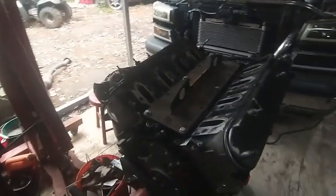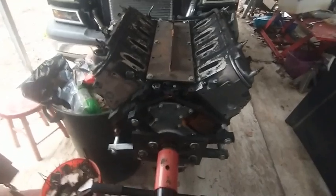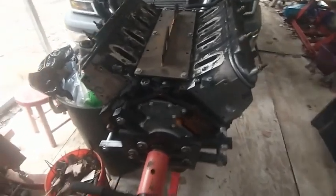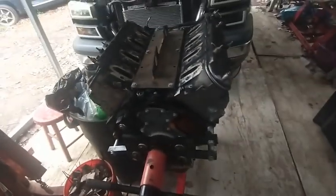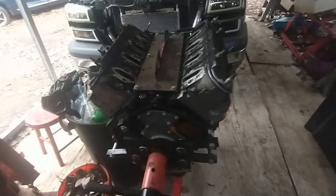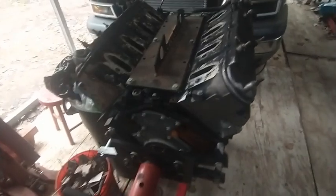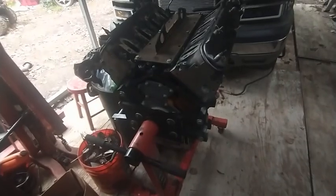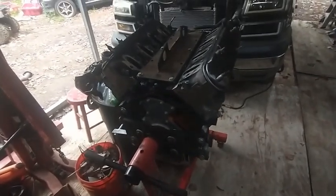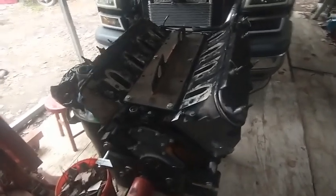So I'm kind of thinking, and I want your guys' input on this, is to, of course, do this on a budget. I don't know really what I'm going to pick for a budget. I think I'd just go about building it as cheap as I can. I think we tear this thing down, inspect all the bearings, everything, rings, pistons, all that, check the bores. Main thing is that we try to avoid doing any machine work, because machine work is ridiculously expensive, like everything else nowadays.